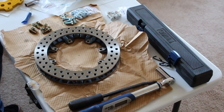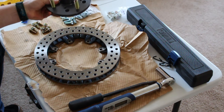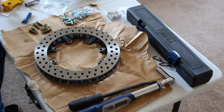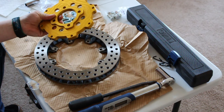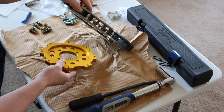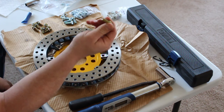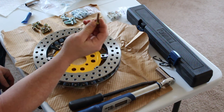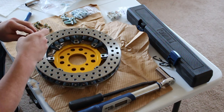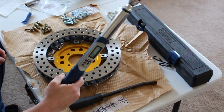We're going to start building this brake rotor assembly and then mount them to the hubs I also bought from Techno Toy Tuning. We'll start with the rotor that Wilwood supplies for the kit, and T3 makes these awesome hats to adapt them to an AE86. We'll put them upside down, slide them underneath the rotor, line up the bolt holes, then start finger tight with the bolts and a little bit of Loctite. They also supplied lock washers, and after that we'll torque to 24 foot pounds as T3 specifies.